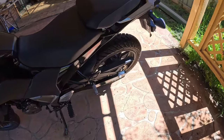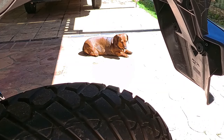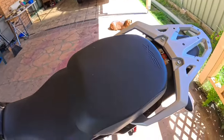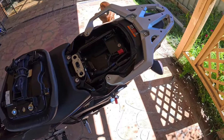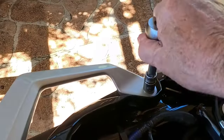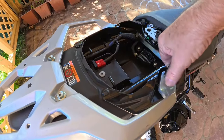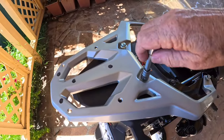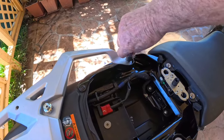That's one plus with these Suzukis - even though they don't cost much money to buy, they put them together pretty well. The seat removal was just a matter of turning the key and pulling it out - really fast job. Now you're down to the stage where you remove four bolts, 12mm, two at the back and two at the side. All 12mm, so it's a fairly easy extraction, and then it's straight on to the foot pegs.